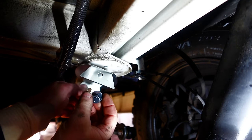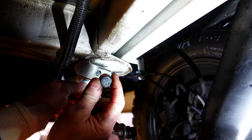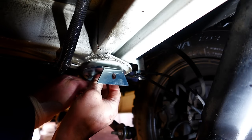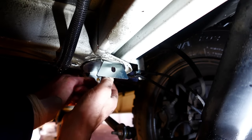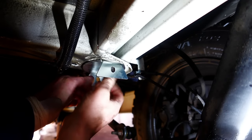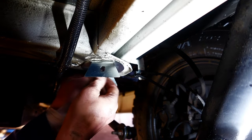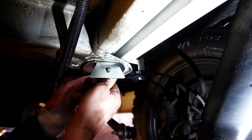So the next little bit is the 10.9 grade bolts. So there's different tensile bolts. These are 10.9 grade, which are heavy duty bolts. Not that there's any comparison. The only other ones we've got are some 8mm on this job that are 8.8 grade. But these are the heavy duty boys that actually go back into the chassis. So I'm just going to screw these in with, hang on, we need copper grease. So there, he's all greased up now. That'll actually make it go in a bit easier, and obviously if it ever needs to come out, it'll make the job really easy.